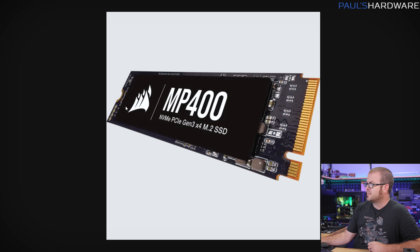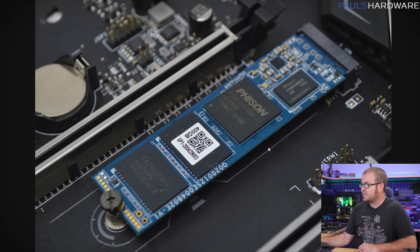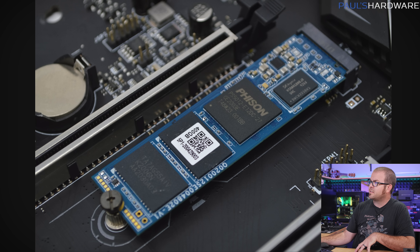You might have an SSD that looks like this with a big old sticker and you can't really tell what's underneath or what's going on. But if you have an M.2 NVMe SSD and you notice it's running warm, or if your read and write speeds are dropping after sustained operations — likely due to heat buildup — then consider a heat sink on your SSD. Yes, you can put it right on top of the sticker if need be. Just keep in mind that the thing you're actually trying to keep cool is the controller; the NAND flash is less of a concern.